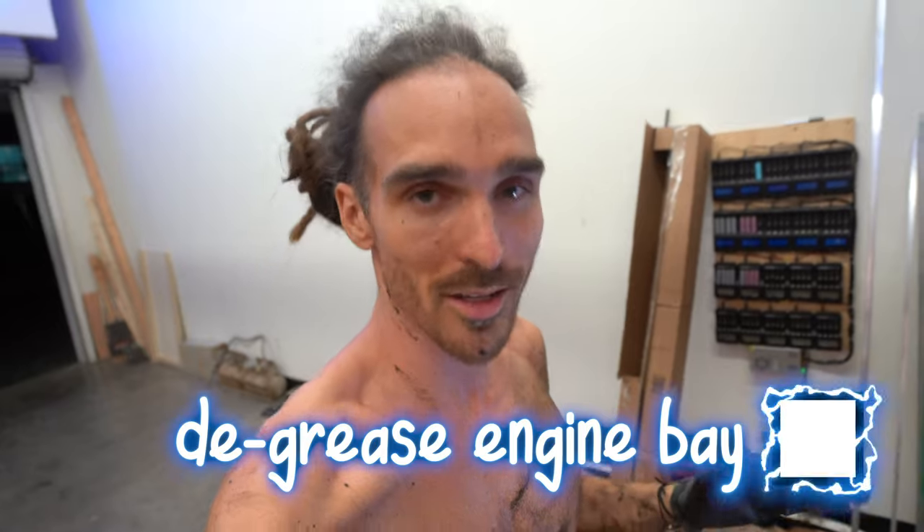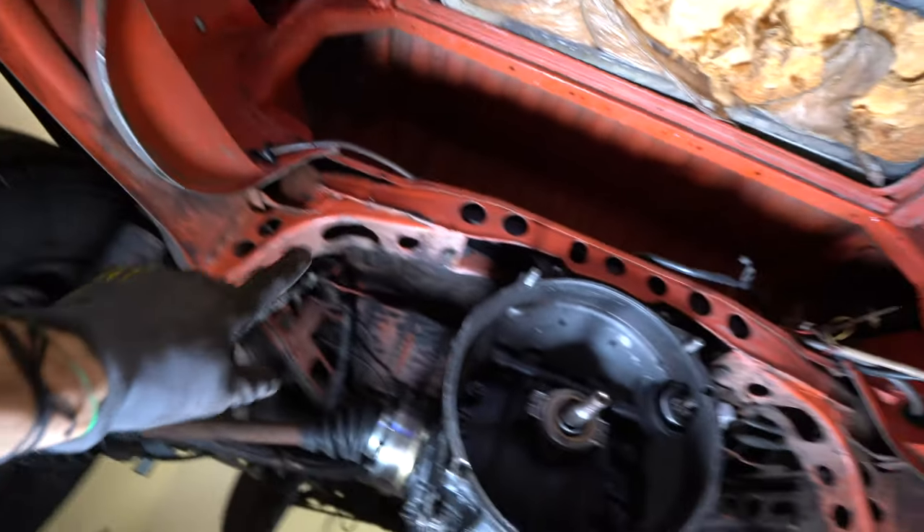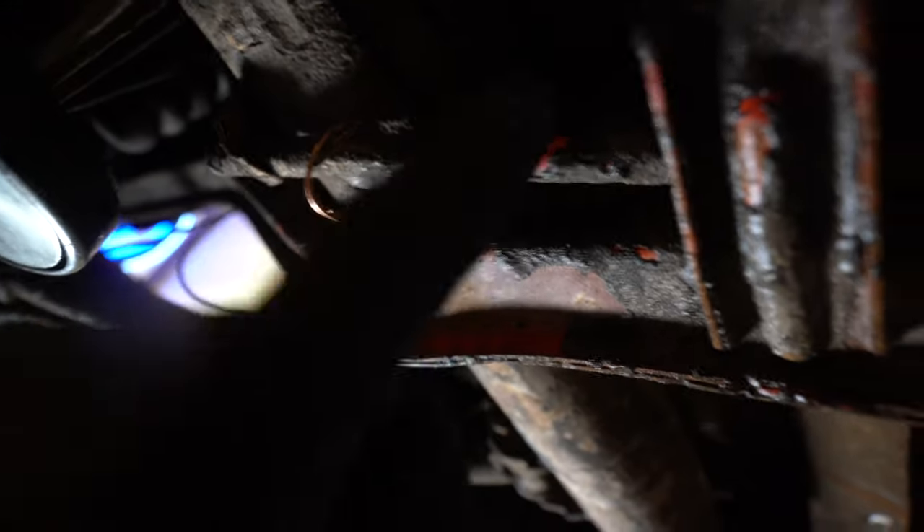I pushed my van back into the workshop and lifted it back up on the lift. It's not perfect but the underside was all thick with grease — it's clean enough now. The next job is to rerun the brake cables. They were coming across here out of this little pipe and across the middle section, but we've had to clean all this out to put the aluminium boxes in. So I'm going to angle grind this out and then drill holes. I've bought three more of these rods to run — one for the clutch cable and one for each brake either side. The brakes will thread through here, through this beam and this beam, replacing where the old pipe was to feed the brake cable through.